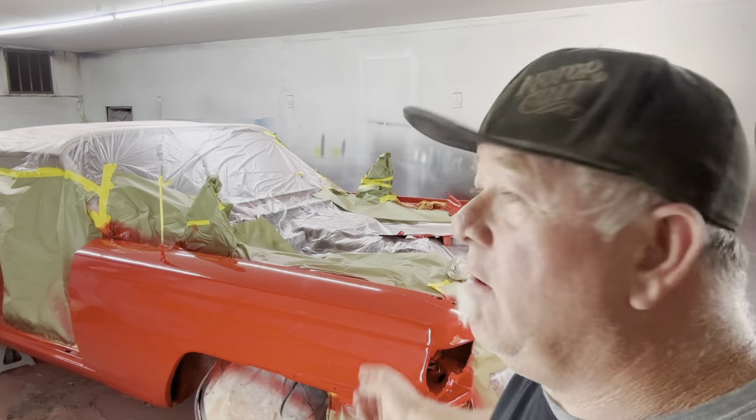And then you're gonna have a final polish, not a glaze. Don't get glaze. If it says glaze on the can for anything you use, don't buy it, okay? All glaze is gonna do is fill in your scratches, so you're not gonna see them when it's all done. As soon as the sun hits it, it gets wet, you wash it, all that glaze comes out of the scratches and it looks all scratchy. Glaze is a filler, it fills in the scratches. Not good, okay? So we're gonna go ahead and sand this out.